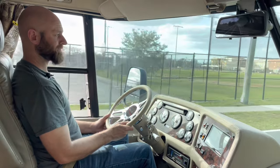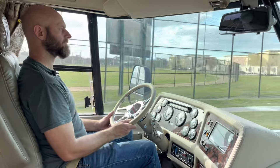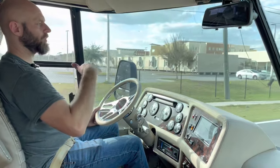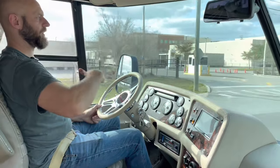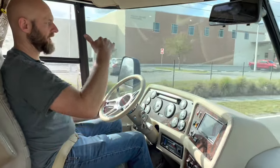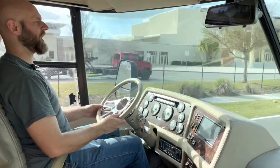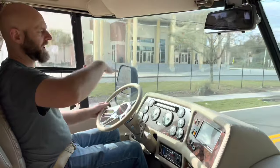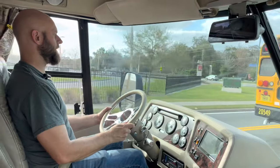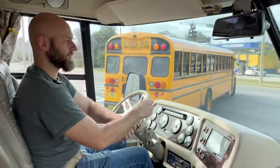About how high the ball is supposed to be off the ground or something like that. Does that sound right? Yeah, that sounds normal. We'll have to get the thing level and then stick a receiver out of it and see where it comes, and then we'll know if you need to drop or raise. We'll assume you'll try to tow with it at highway speed a little bit low in the rear, and then you'll be able to raise it up a little bit. It shouldn't affect too much.